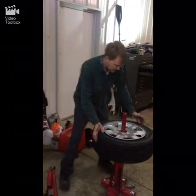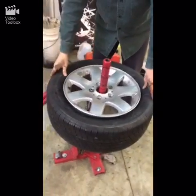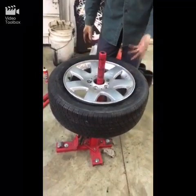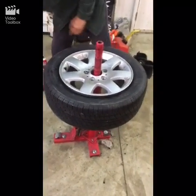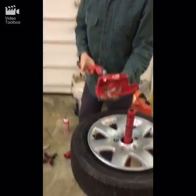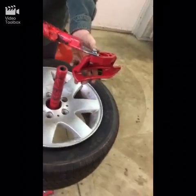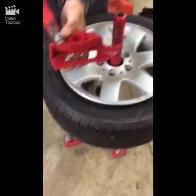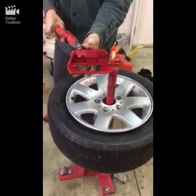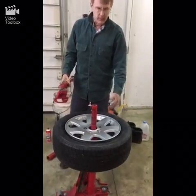So the first trick I'll show you is we've got our rim here. It's a BMW 15-inch rim, a typical passenger tire, and we've broken down the bead with the breakdown tool. The beads are broken off both sides of the rim. The key thing we've got is this mount/demount head — I'll put a link in the description where you can get it from Amazon. It's about a $15 tool you can add to the Harbor Freight tire changer to make it almost touch-free and much kinder to your aluminum rims, so you'll never have metal touching aluminum when mounting and demounting. We've found this works great on passenger tire rims and doesn't damage the paint or finish.